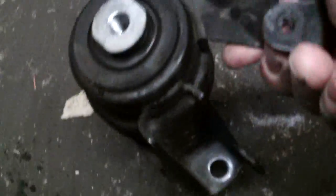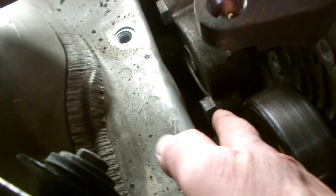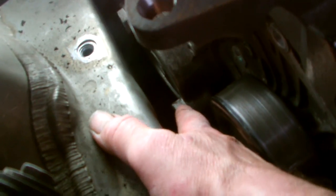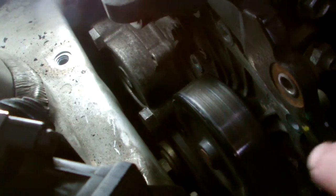The engine mount is off here and there's an adjuster on here. Through that we get a jack to hold up the engine. And with that all out of the way, you can release the fan belt — just push back the adjuster here and remove all the studs around the old pump.